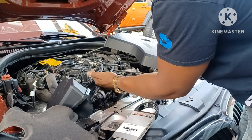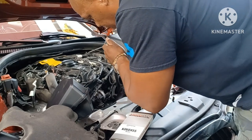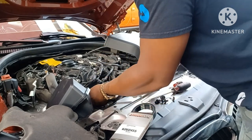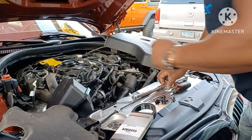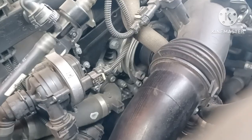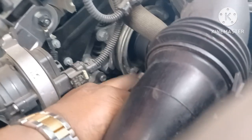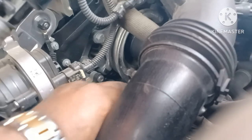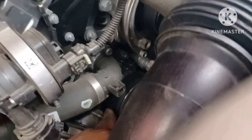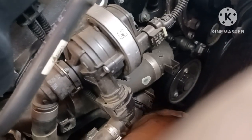Get it as low as you can go, then crank it to the right a little bit. As soon as you crank right it releases tension — I pulled it off my water pump in the center. Let it down and you're good to go. I cranked it right there — when you crank right the wheel drops down, the belt gets real loose, and you just unhook it. I slid it with my finger and it came right off.